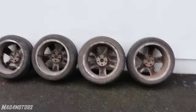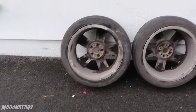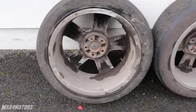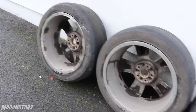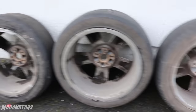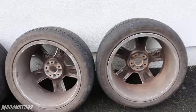We know the front face of these wheels doesn't look good but that is not important when you are going to look at a set of wheels for your car. The most important thing to check is the back of the wheels and what we are looking for is any buckles or any hairline cracks. I always try to look for a set that may have a little bit of damage on the face but that they are straight and true so we won't have any steering issues, wobbles, or vibrations.